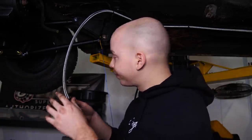Well, the fuel pump isn't getting power, which is a little annoying, but for now it doesn't matter. I did determine that the black wire is indeed the ground, so we'll go ahead and wire it up and then give it some switch power later down the line. It's probably a good idea to put it on its own relay instead of wires anyway.